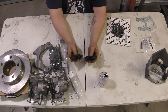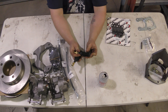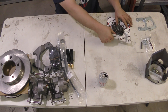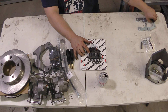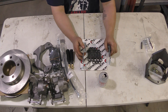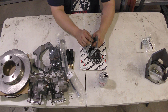I've also got an air breather kit, which allows air to go in and out but keeps water out of the axle housing. And I have new T-bolts for the axle housing ends, which hold the retainer plates that sandwich the axle shaft into the axle housing itself.